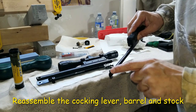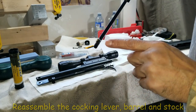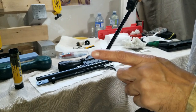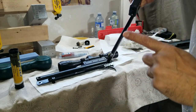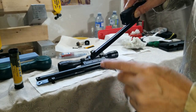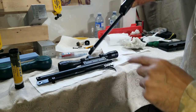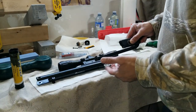When you put in the sleeve — this is really important because every Dyna has this issue — when you put in the cylinder sleeve, that white Teflon piece, you have to trim it here because this is too long and it doesn't work well; it's gonna rip off the sleeve. You have to trim it like this with a hand filer. It's very tough material, so take your time and make sure it's smooth so that it goes inside easily.